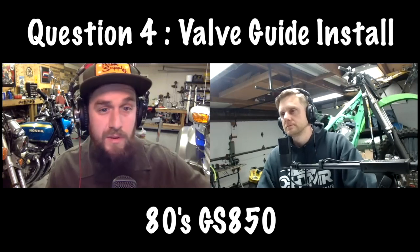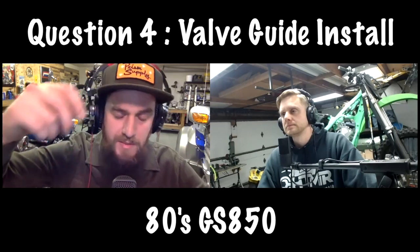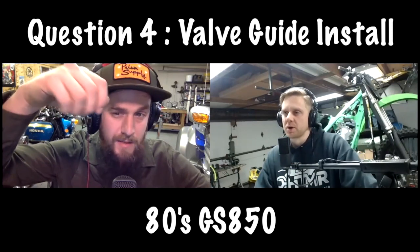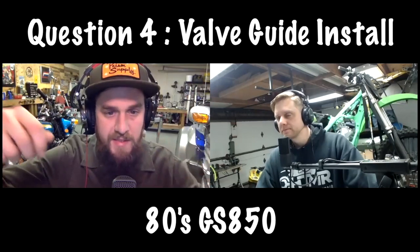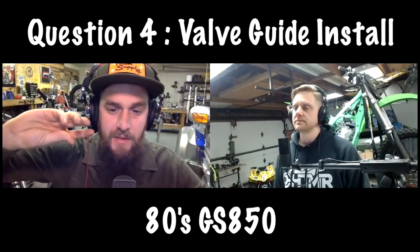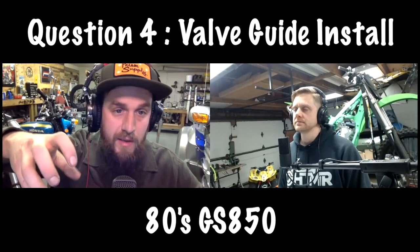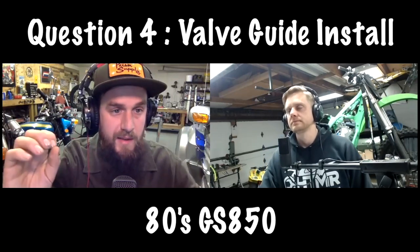Like we said with an earlier question, there's that paste, it's like blue. Dykem blue. It's like a paint. Prussian blue. Yeah, Prussian blue. You put it on the seat, and then you put your valve in and simply spin the valve in the seat. There's going to be a contact patch that gets worn away from it contacting the seat, and then you can say, okay, this is what needs to happen.